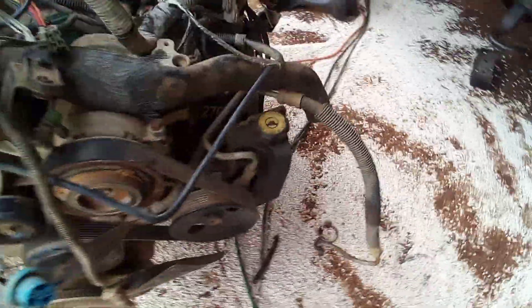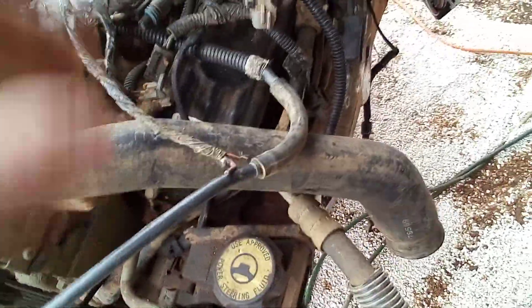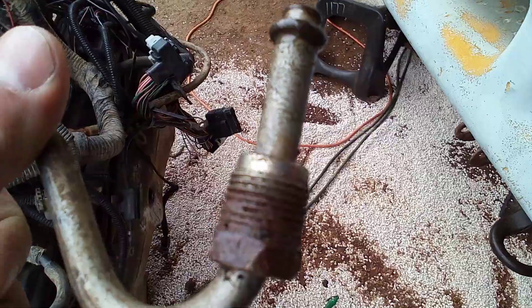Other important differences are the power steering pump, which exits from the top on this one. This I'll have to change to a Dodge one, which I have got in triplicate. Although, according to their name, it's got the same fitting as the Chevy does on it, so if you want to put it down into your Chevy steering box like I've got, this will probably just hook right up.